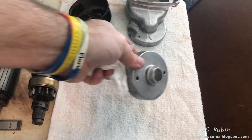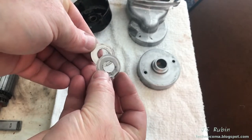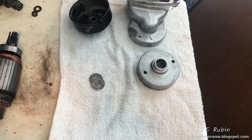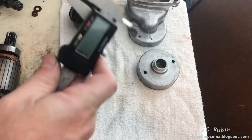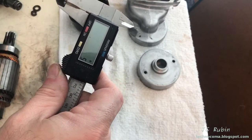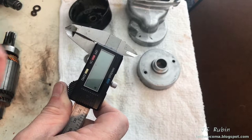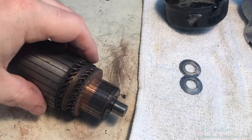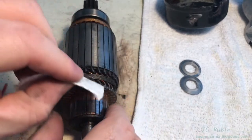This cover also cleaned, onto the finish table. I'm suspicious of these thrust washers, supposedly part number 31584-73. Most notably, when I measure them, one is ten-thousandths of an inch and the other is twenty-thousandths of an inch — even though they're the same part number. That needs to be investigated. I try cleaning a small section of the commutators just to check the condition and make sure everything's looking okay.